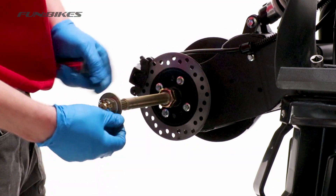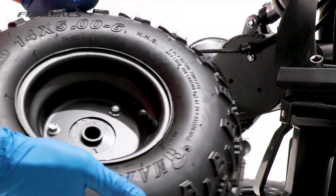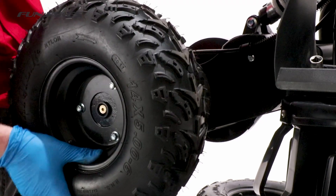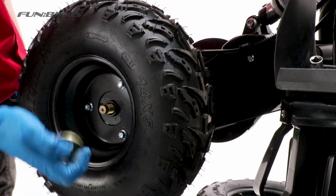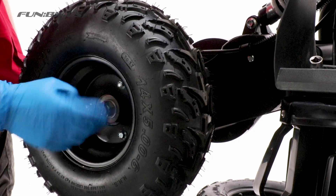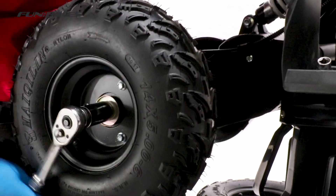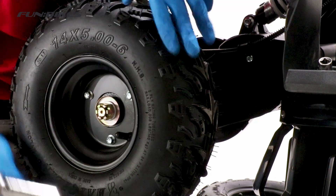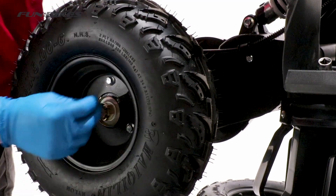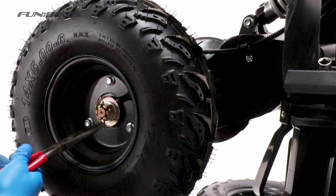We are now going to attach the rear wheels to our quad bike. Remove the split pin, castle nut, washer and spacer. Take your rear wheel - you will see there are direction arrows on the wheel. When the wheel is placed on the bike and the arrow is at the top, it wants to be pointing forward. This is the direction the tyre will spin on the vehicle. Reattach the spacer, washer, put your castle nut on and then fully tighten using a 24 socket. When tightening the rear wheel, hold the back brake on to stop the rear axle rotating. Make sure that your castle nut is aligned with the small hole in the axle to allow you to replace the split pin. Once you have the split pin fully inserted through the axle, bend the end over and apply a small quantity of stud lock. Repeat this process on the opposite side.